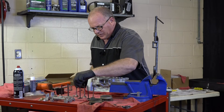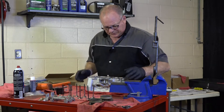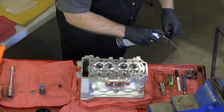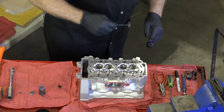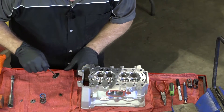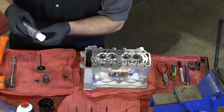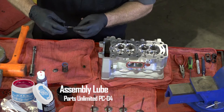When we lapped the valves, remember we had numbered each one. So I've got them laid out like they're going to go in and I still have my numbers on there. I do want to give them one last cleaning before we go in. The reason you lay them out is that once I've sprayed with contact cleaner, if I get any on the bottom side the number's going to disappear. When you're assembling this, use just a little bit of assembly lube on the valve stem itself.